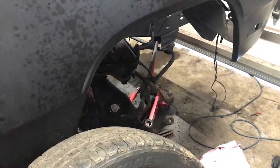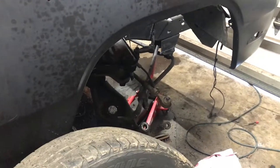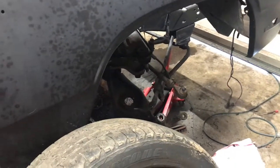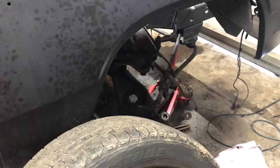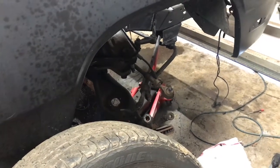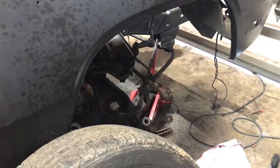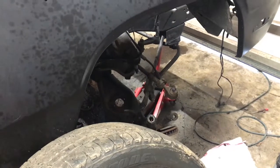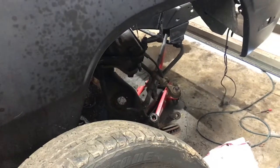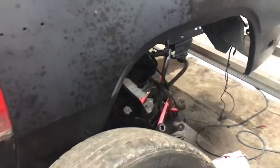The ball joints are actually good — I really didn't want to replace them — but the threads got messed up in the process. I don't know exactly what happened; I zipped the bolt off and it just destroyed the threads on the ball joints. So we might have to put new upper ball joints in if I can't fix those threads. The tie rods are in okay shape and I got new tie rod sleeves for the alignment, but I might just replace them. We might put the truck back together with the old tie rods and then order new ones and slap them on when they get here since that's not really a big process.